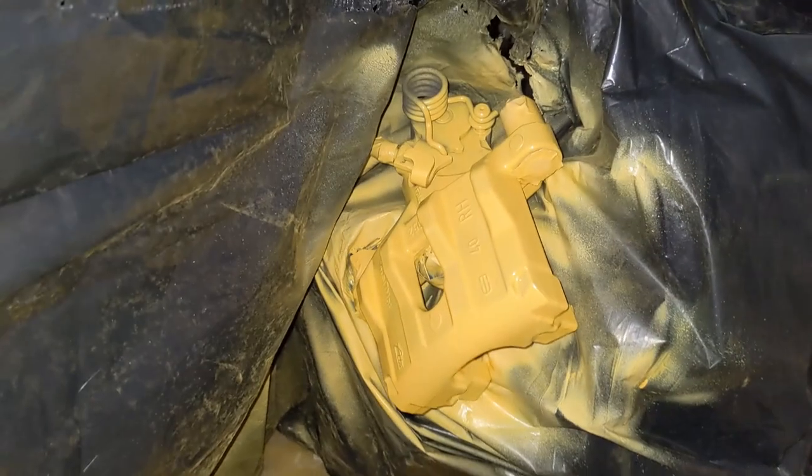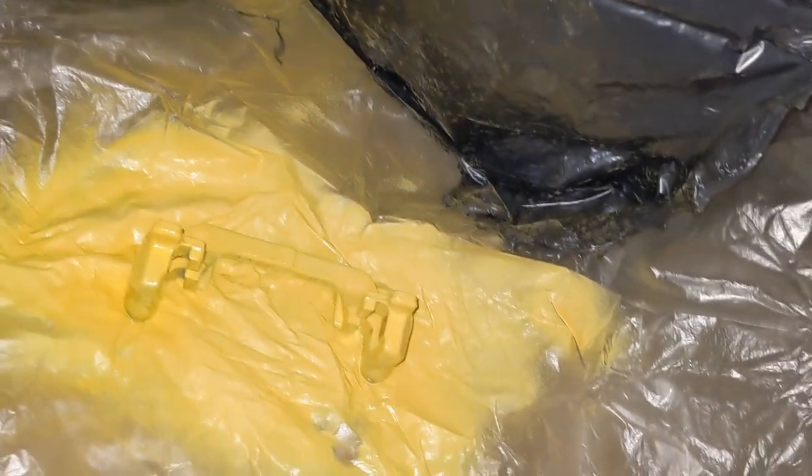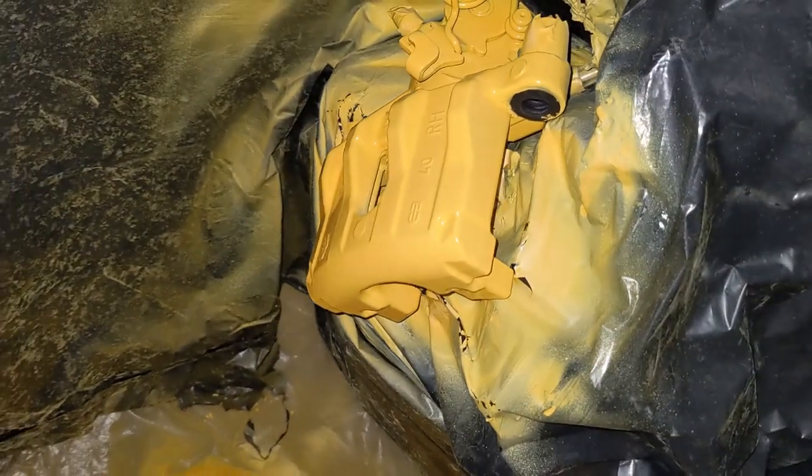The painting of the rear calipers was tricky. The temperatures outside were going down, so I was painting at temperatures of 55 to 60 degrees Fahrenheit, which is the minimum required. As a result, the paint cracked in a few places, so I had to repaint it. This time I used a heater to dry and cure the paint quicker and provide optimal temperature as per instructions. Weather was not in my favor, so I used a heater to bring the temperatures up as much as I could.